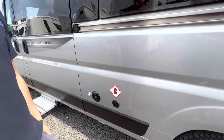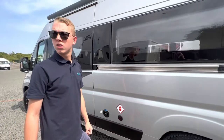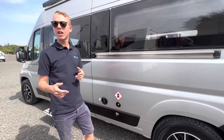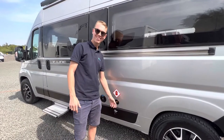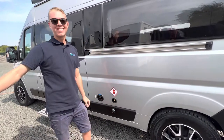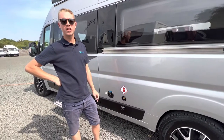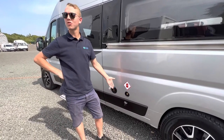This model is fitted with a 25-litre underslung LPG tank, which means you don't need to use a bottle. You go to your LPG centre, get the connector, pop it in the van, turn the connector, press and hold the button on the filler, and fill with LPG until it simply doesn't take any more. From empty, something like this will take about £25.